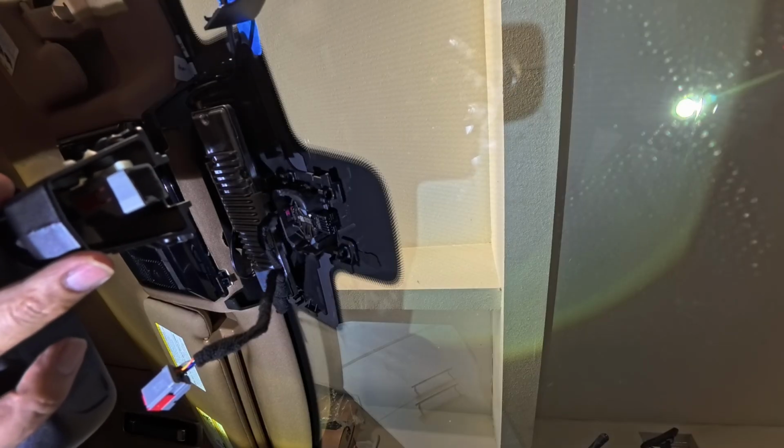Okay, so now we are ready to assemble the camera back up again. This is the sensor cable that we were looking for. We need to get power. This is the mirror tab, and again, we cannot put this mirror back in first, because then routing the cables all around was going to be a problem. Because after I install this console, I won't have access to this area, because I have the combo, the front and the rear.